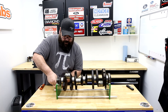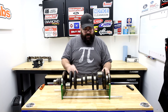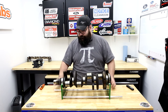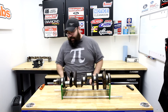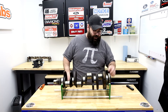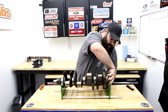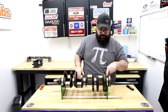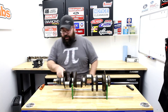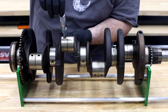With this, you can basically set your crank up here and spin it to get at all your different journals. This adjusts, because at some point you're going to need to measure this, and you may or may not need to measure this journal — that's really the rear main seal. But if you needed to, you would just pick it up, and now you can measure that. Because you've already measured this one, if you picked this up and brought it into that journal, you're free to measure this one. It's super convenient.